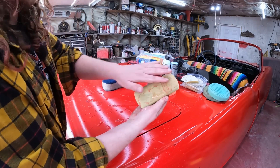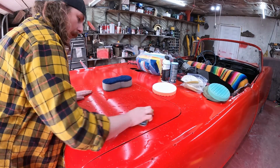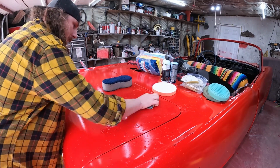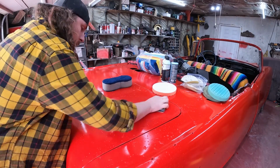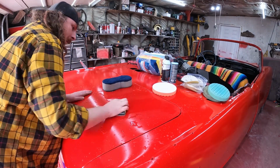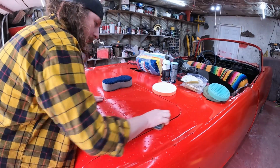So it's not plugging up the paper, so you kind of turn that red water, which is good, means the paint is, I'm going to say, hard enough. I'm definitely going to want that pad, I think, because this paint is pretty hard. Or we'll have to go to a rougher sanding paper, which I feel like is what's going to happen immediately.